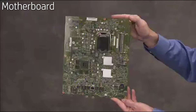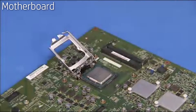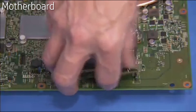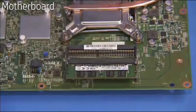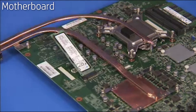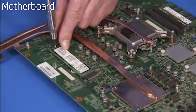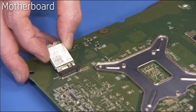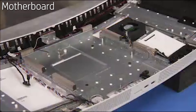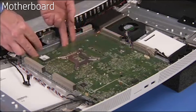If installing a new motherboard, install the old CPU, thermal module, system memory, and the M.2 SSD hard drive if present in the unit to the top of the motherboard. Install the wireless LAN board to the bottom side of the motherboard. Carefully align the motherboard top side down into the unit, aligning the bottom I/O connectors into their cutouts on the rear cover and clearing any connectors away from the underside of the board.